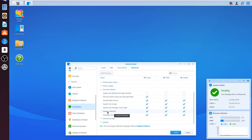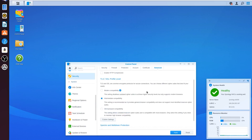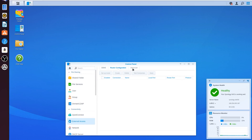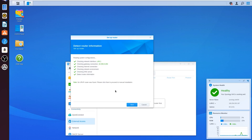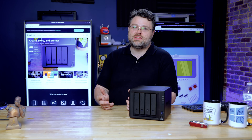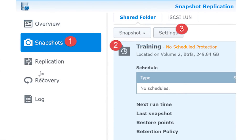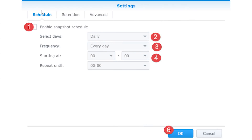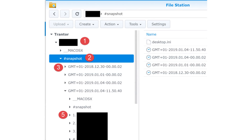You can absolutely DIY the office sharing and everything else, but in terms of maintaining that system, doing the updates, making sure the software is up to date and everything works, it's going to be a little bit more headache. Most NAS appliances — the companies behind them — do actually put work into maintaining their software base and testing, and Synology is no different. In the event that something does go wrong, you've got the option of setting up more than one Synology, setting up snapshots and replication. You can browse your backups, use a timeline and see where the file was at a point in time. You can roll back with Synology software and the point-and-click GUI and cherry-pick that one file. You don't have to restore everything.